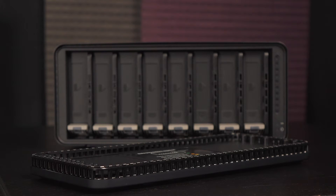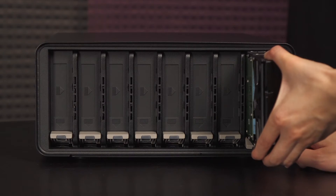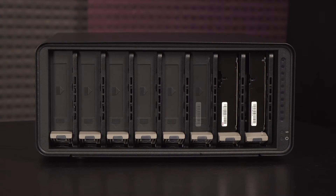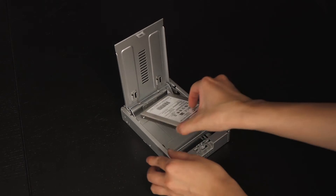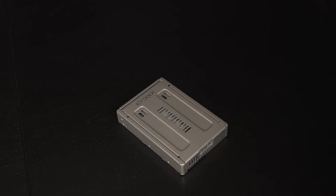There's plenty of vent holes all around the drive bay cover so everything stays nice and cool. Let's install some drives. Press down on the tab and carefully slide the drive inside until it seats. I'll do the same for the other 3.5-inch drives — there's only one way to install them correctly. Time to slot in the 2.5-inch SSDs. Press to open the IcyDock drive converter, then place the SSD inside the housing. Lower the lid and click to secure everything in place.